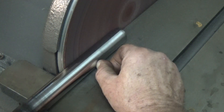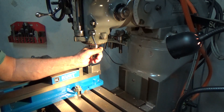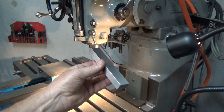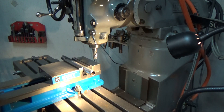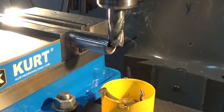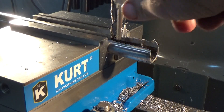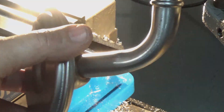Use a disc sander to clean it up a little bit — looking better. Now I'm going to use my mill with a three-quarter end mill, because the pipe on the pickup is three-quarter inch, and I'm going to mill a slot down the center of that piece of tubing. As I'm milling it, I'll take the tube and stick it up there to see how far I need to go. I'll go a little farther than needed so hopefully this tool will work on other pickups too. If I slide that in there — looks really nice.